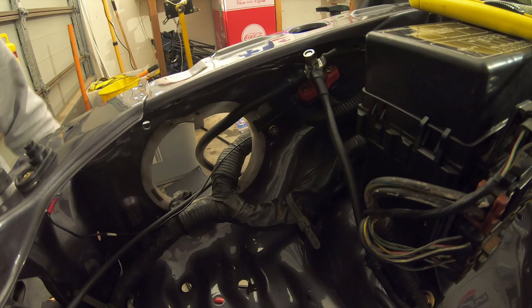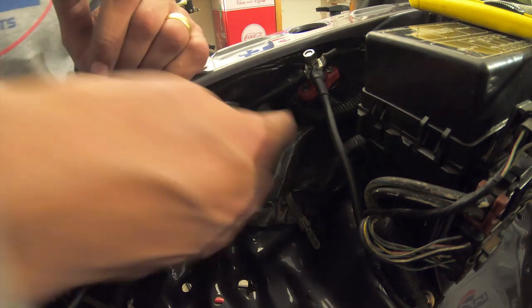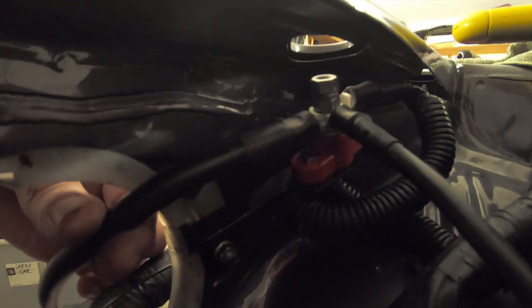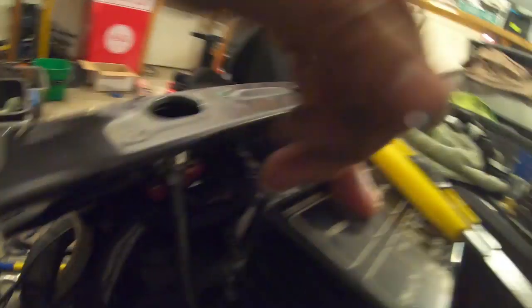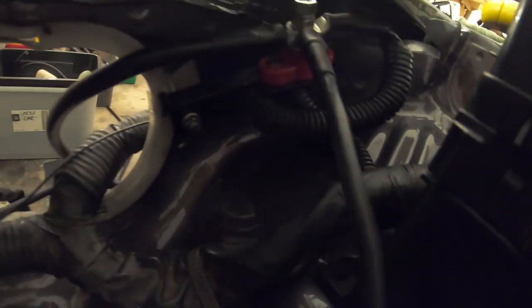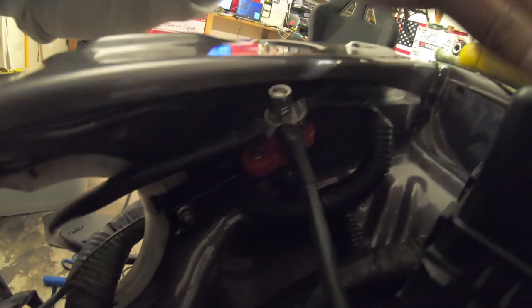As you can see, the jumper is mounted on the bracket and I just feed all my eye terminals over the top and secure them with the two bolts. I've fed a power line from the battery — this is the factory line that feeds the harness. You've got your alternator and starter down there, that same wire comes up and feeds off here. So you get direct power from the battery to the alternator and starter, and your accessory for the fuse box and everything else in the engine bay feeds off that as well. The only thing to do now is to turn it on and test it — hopefully my house doesn't catch fire. The alarm light is on, interior dome lights are on.